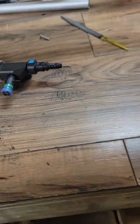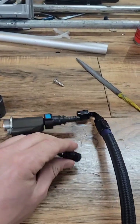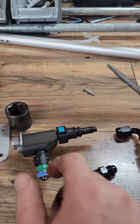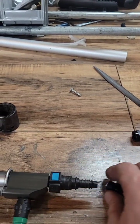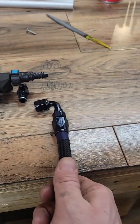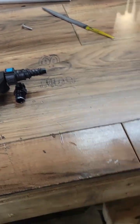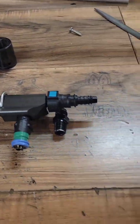So I figured I'd complicate things by putting some race car parts onto this here snowmobile engine while I swap it into my airplane. We're just going to lop that off of there, then we'll tap the hole there for the right size of this, hook it on there, then we'll have this here 90 degree AN fitting that I got out of the bargain bin. Stick that on there, and then we'll run this other end down to my fuel pump, and presto bang-o.